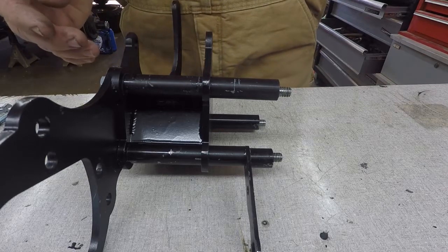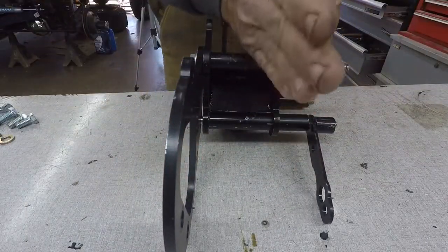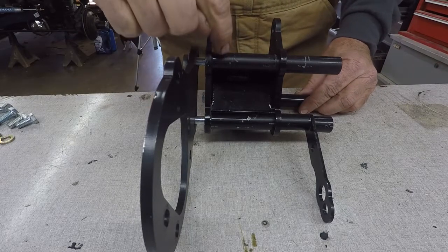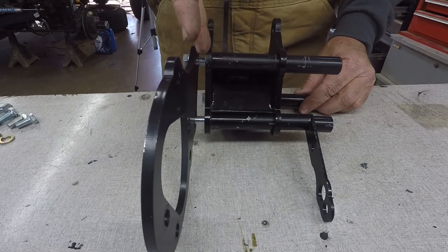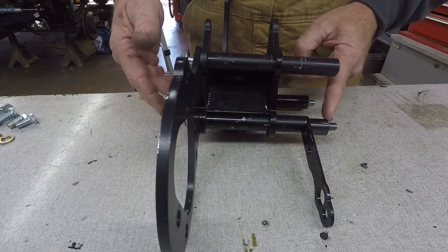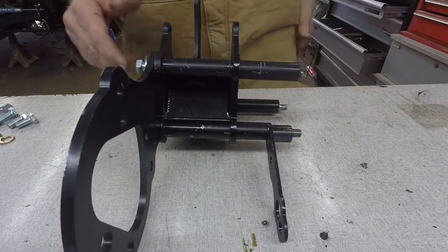So the problem is that it brings the power steering bracket too far back, so they won't line up. So it has to get spaced out like this, okay? What you do is you use those pieces you cut out of here and here, you use those right back here, okay? And the third piece that you cut off this other side, you're gonna end up putting back over here on this side, okay? Does that make sense? That should line everything up perfectly the way you want it.